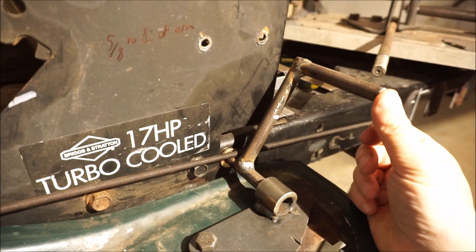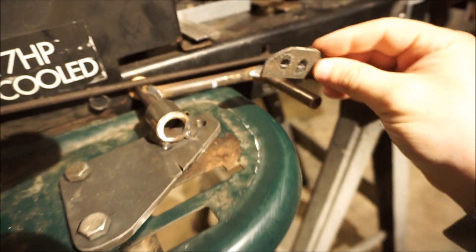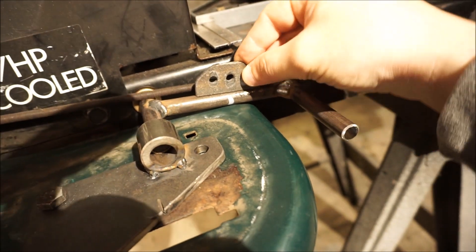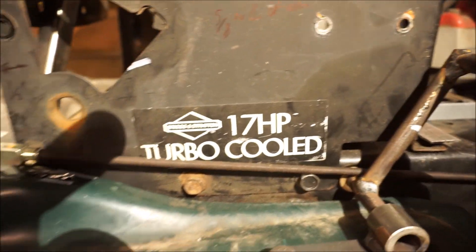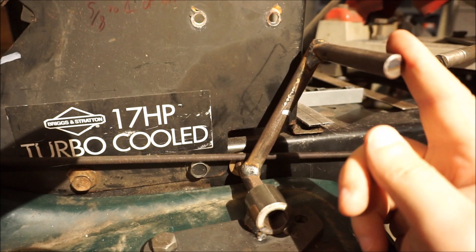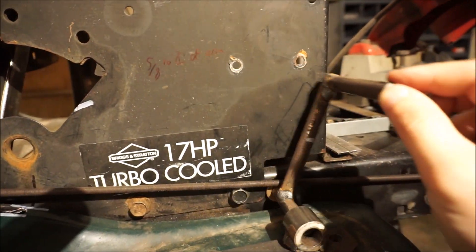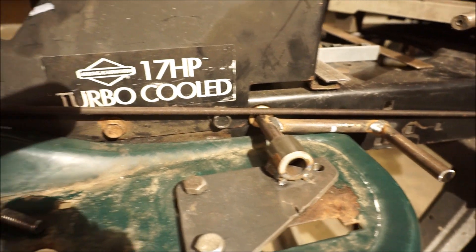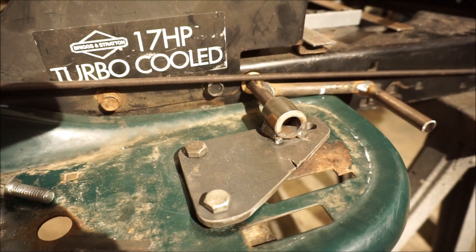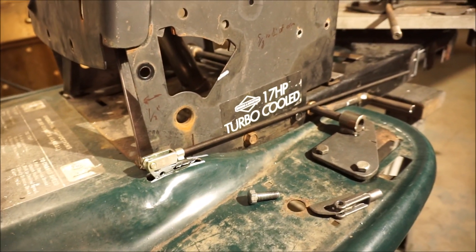For the brake pedal I'm making it basically the same height as my clutch pedal and figuring out my leverage points for the arm that goes to the master cylinder. I made this up from round stock — nothing too crazy. I also made four little pieces from eighth-inch steel with quarter-inch holes — going to wing it and weld them on and see if the leverage works out. After that I'll set the length of the threaded rod that goes back to the master cylinder, which will also let me figure out the final brake pedal position. I'll probably weld some flat stock on it too to make it more of a proper brake pedal.